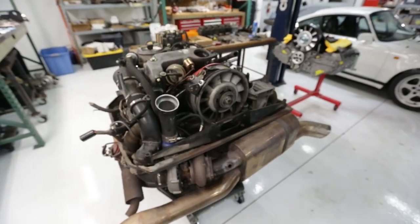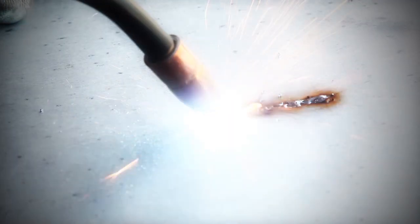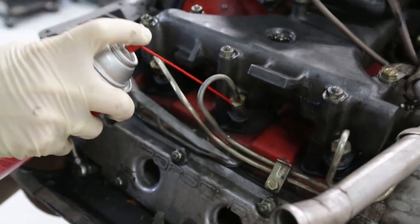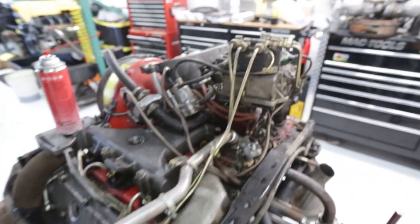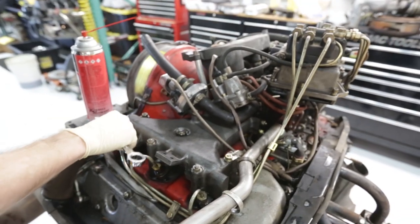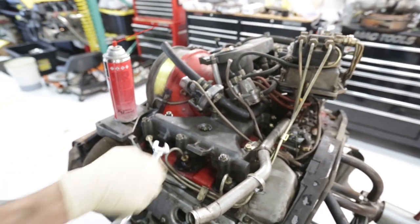It's day two at Turbocraft, and today we break down the 930 motor and determine its bill of health. So we're starting the teardown by removing the fuel injectors and the fuel lines. Yep, take these big lines off of there, get them out of the way. Then we're gonna take off the entire CIS in large chunks. This off, manifold off, put this thing down to a long block, flip it over, repeat on the underside.